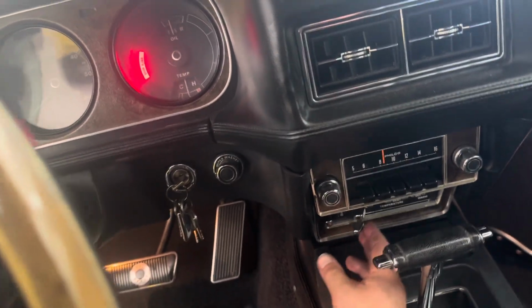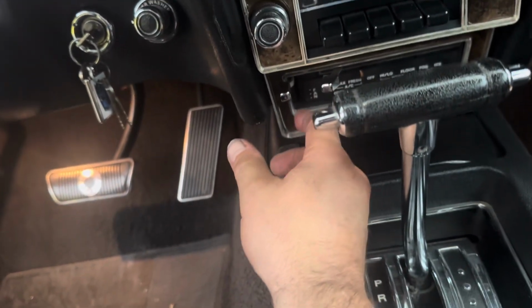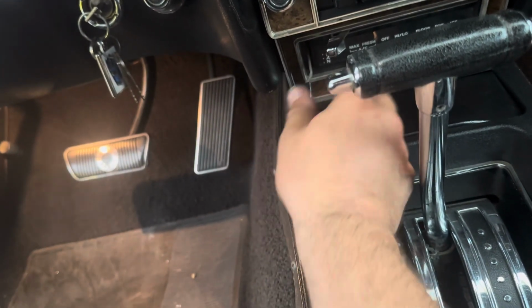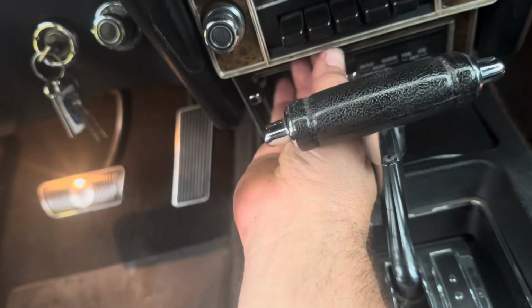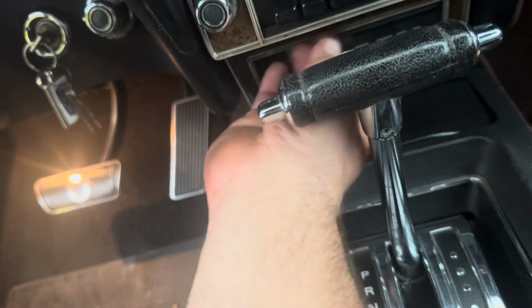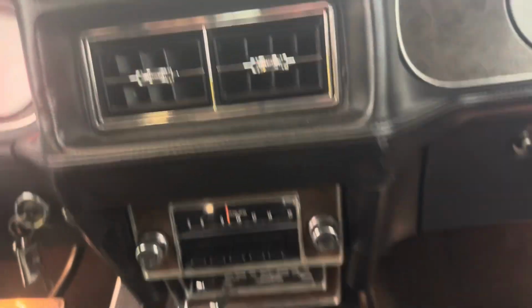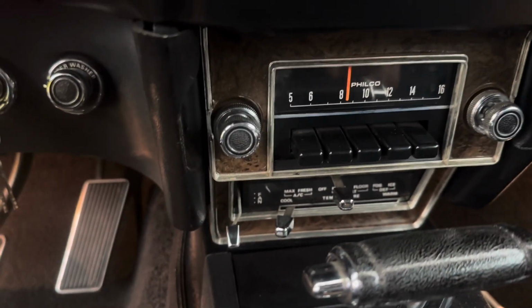There's definitely vacuum issues and there's power issues we've got to dig into on this baby. You can hear it do the hiss, but it's not changing the mode doors, nor is it switching on our compressor. I just want to see if the compressor's locked up or not. Check for power. That's about all I'm going to be able to do today.